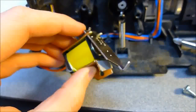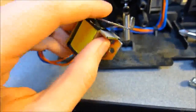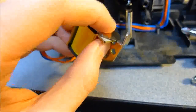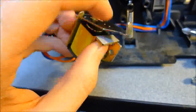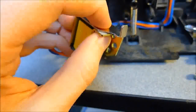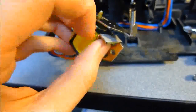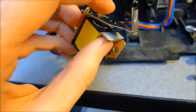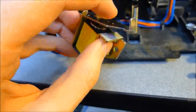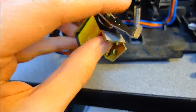Once you've taken care of the other two solenoids for Tray 1 and Tray 2, right before you put it back on, go ahead and give it a try. You should be able to press on the armature really hard and still not have it stick at all. That should mean that the adhesive, thanks to the little electrical tape put on there, is not going to pose a problem and we're not going to have any issues with residual magnetism either.